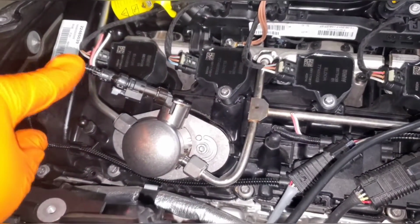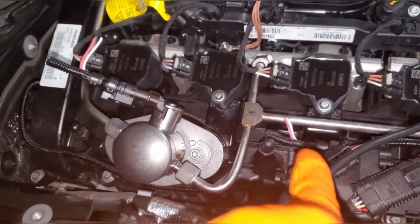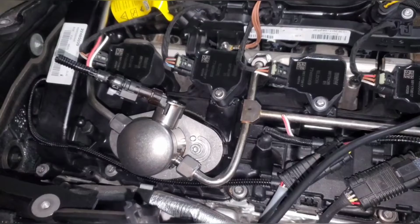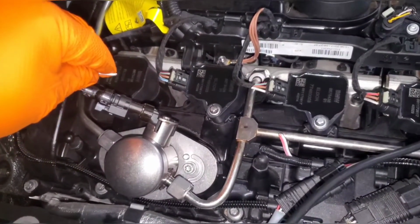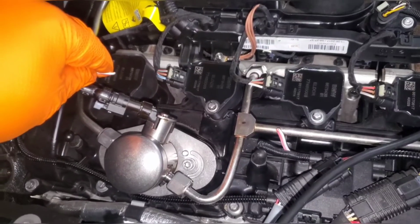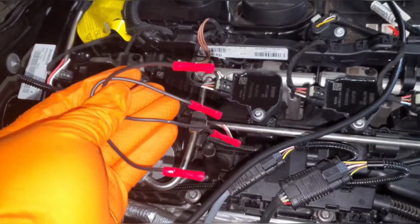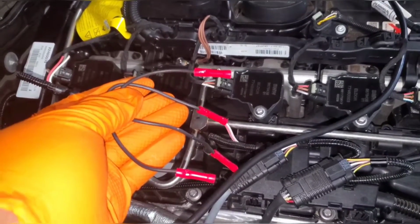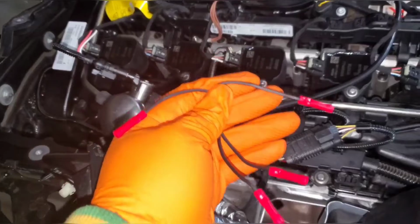Alright, so here's the wires that I cut. You can see I just have the connector installed. This is the wire I cut on the connector side, and wire at the base. So all I did was angle this, measure the length, and it was 6 inches. So I have 7 inches of wire that I cut and crimped. Also, I am using crimps, I'm not soldering.